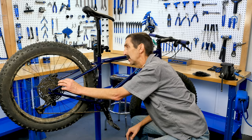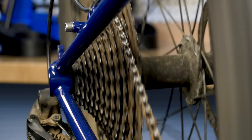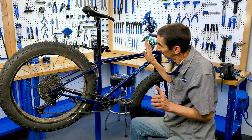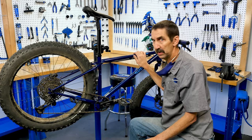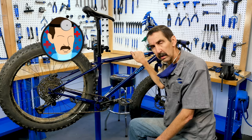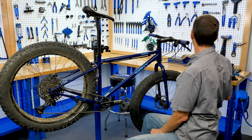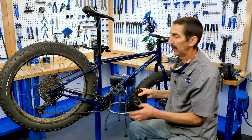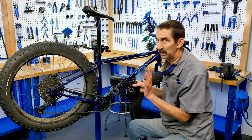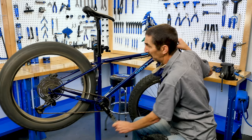So what was going on here? I would have loved to have been a fly on the chainstay when that happened, because I suspect it happened all at once with a monster power stroke and a bad shift — the timing of it, an unfortunate shift may have pulled that sprocket over. Whatever it was, it's pretty much history now. So you're on the trail — what can we do? Don't use it. Doctor, this hurts. Doctor says, don't do that. Now we've got a 10-speed, started with a 12. Just don't use it, get back home. Can we fix it? Not really, not a good fix. You would have to bash it back in, and there's no room to pry. If you did, you've weakened the metal — weakened it once, weakened it twice. Replacement is really what we need, but diagnosing the issue — that is the important fix.